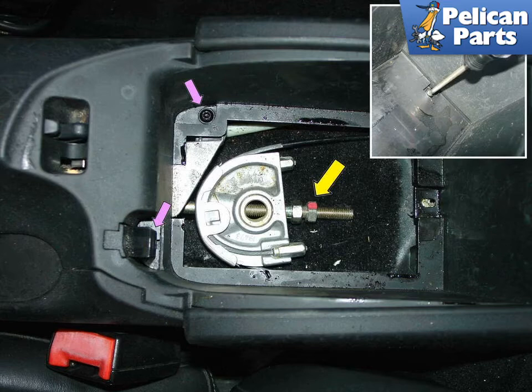The 2005 and later vehicles have a new automatically adjusting control cable on the parking brake. You will still need to adjust the brake shoes as shown in the previous image, but the parking brake handle is designed to self-adjust the cable for its entire service life.